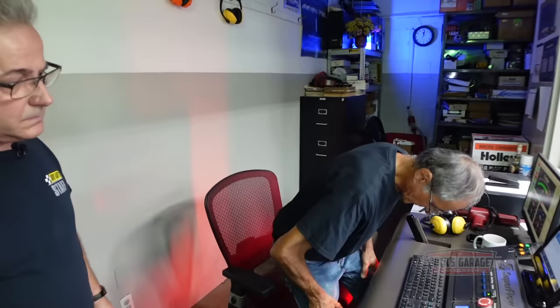Concerned about right now. Now you don't want to fix this O2 sensor. Yeah. What are you thinking? I'm thinking every time I go back to idle, I want the car to idle 900, 950. Okay. And I got to fix this here, not on the car. Yeah. And once we fix that, we're gonna go with the air cleaner on. Okay. I just want to make another test now. I put it at 35 degrees. Okay.